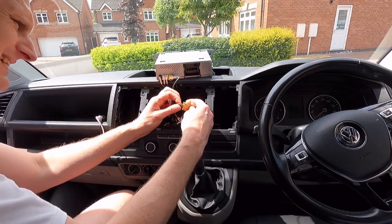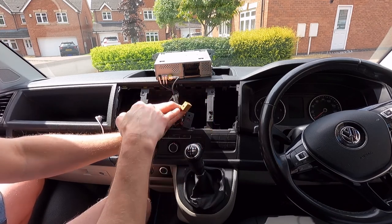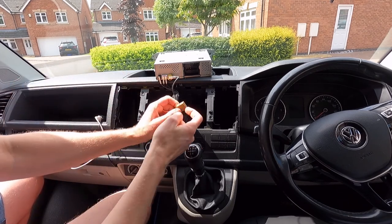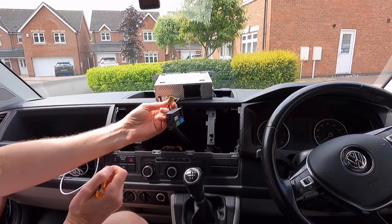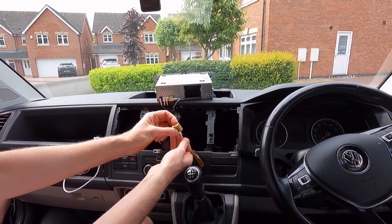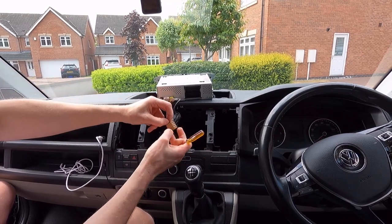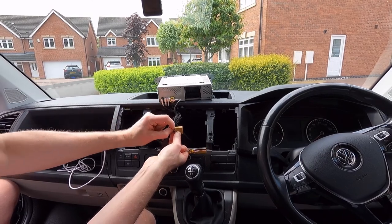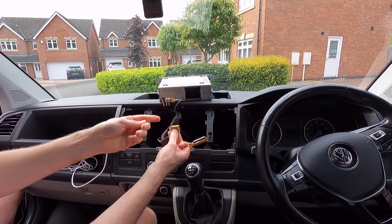And then there's a little pink cap that goes down the middle, and that holds these clips all in. So we've got to just get that slid out. On the bottom of the block, if you use a small screwdriver, pop that in there and you can just push the purple center pin out. Then pulling that up will release the ability to get new ones in and take these ones out. So whatever you do, don't lose this.